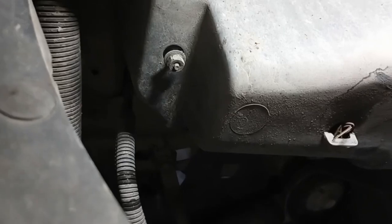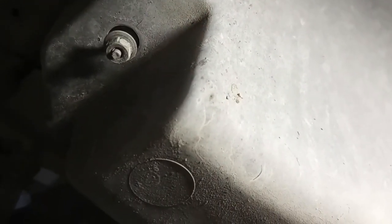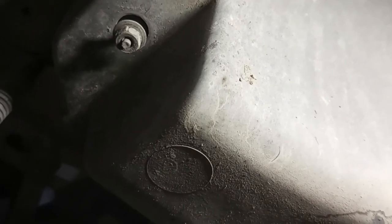Found out how to get the compressor off. This is under behind the front bumper on the driver's side. I got the front driver wheel turned out so I can get my head in there. You got 10-millimeter bolts — looks like three of them: one there, one there, and then one's tucked back in the back. That's your third bolt, and then we should be able to lift it out. Three 10-millimeter bolts behind the front bumper on the driver's side.